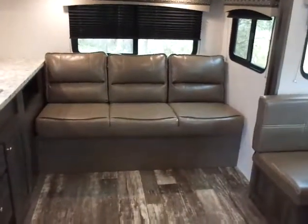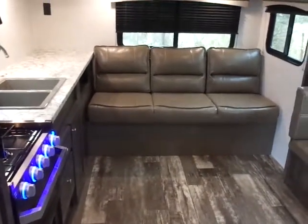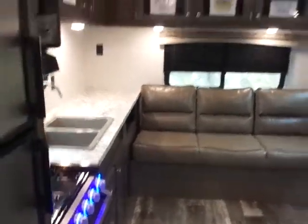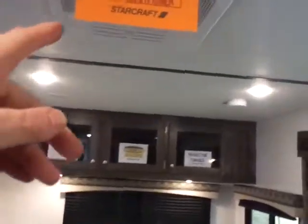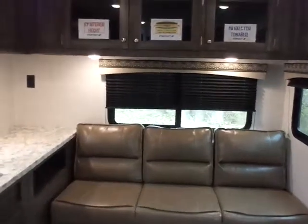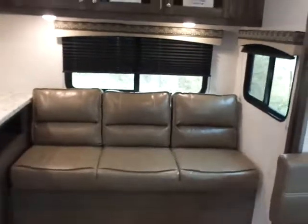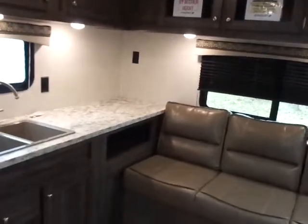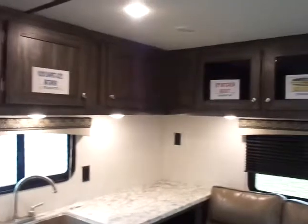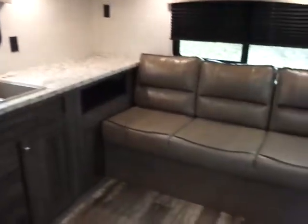The big manufacturers seem to be using the PVC roof material. It has a 15-year warranty and does not need to be conditioned with rubber roof conditioner. That said, it has to be cleaned and all the seams and cutouts on the roof should be checked visually a couple of times a year to prevent water infiltration. It's an ultra bright white with some heat-reflective properties — more reflective than the off-white rubber material we had before.